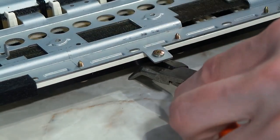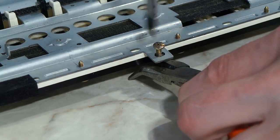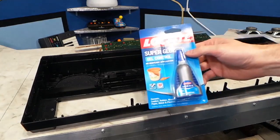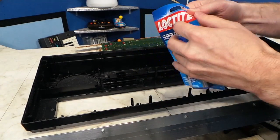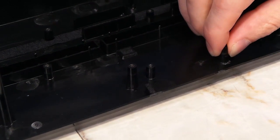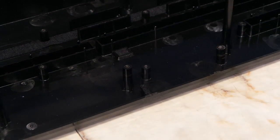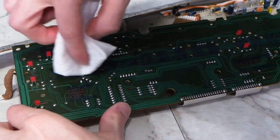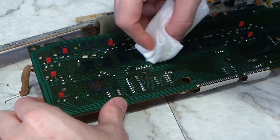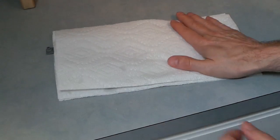Now it is time to deal with this broken plastic. I suspect these were broken due to some large external stress on the keyboard, such as sitting a large object on it or maybe during shipping. The irony is I'm wanting to remove super glue from this part of the keyboard, but I'm going to be using fresh super glue on these plastic stalks — of course, this is the type of thing it's actually meant for. Since the break was sort of lumpy, I had to rotate these to find the exact original position. While that glue was sitting, I turned my attention to the key sensors. There was some residue on a few buttons, but I couldn't find residue on some of the other buttons that didn't work either, so I guess we'll see.